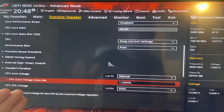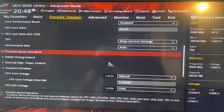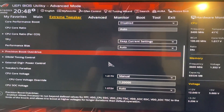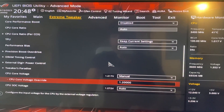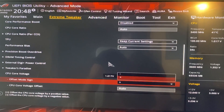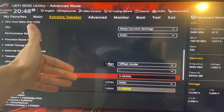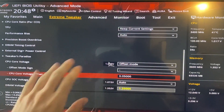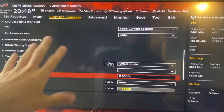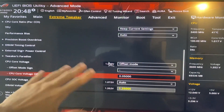In case you want to keep the CPU turbo boosting like it does at stock — going up and down all the time — no problem. Go back and put the CPU Core Ratio back on Auto, and on the V-Core put it back on Auto and change it to Offset Mode. Set the offset sign to minus and put 0.05. Your CPU will run at a negative offset of 0.05V the whole time, running cooler, quieter, and better without changing the core clock.